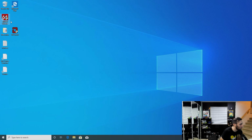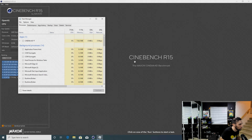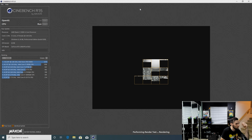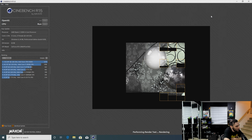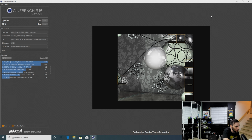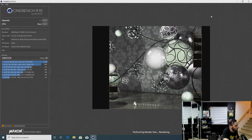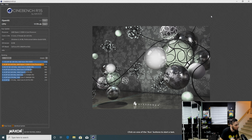And let's do a quick Cinebench. Make sure CPU is at 0. All right. And we're done. If you have any questions or if I missed anything, post it in the comments down below. I don't think I missed anything, but I kind of did this on the fly with no script. I just went through it, so I probably did miss something. But yeah, post it in the comments down below, and I can help you out with your Ryzen overclocking. Shouldn't be too hard once you've just followed the guide. There we go, 1180. So that's also a good number for 4.4 gigahertz, right? 4.5 gets you like 1200. Big deal. It's not worth the voltage increase.